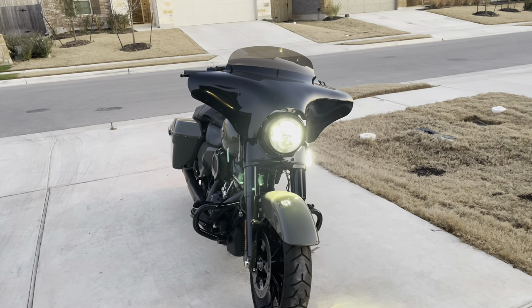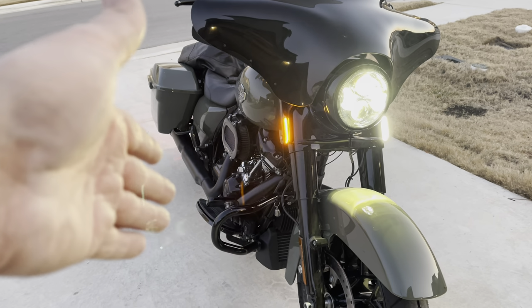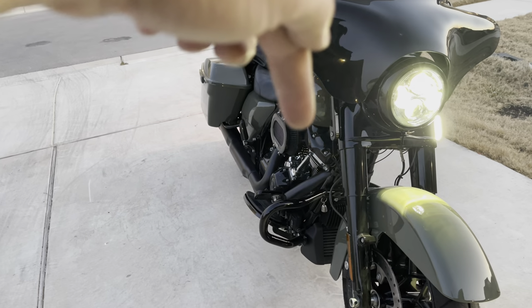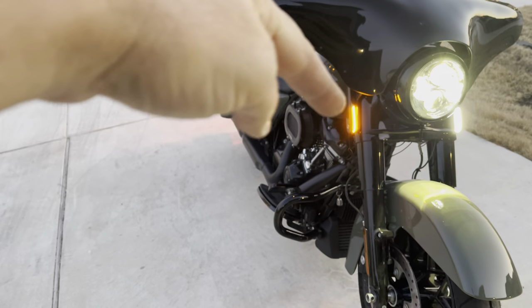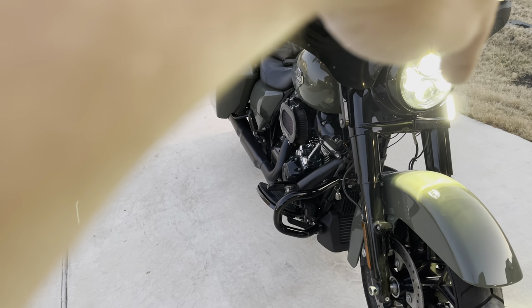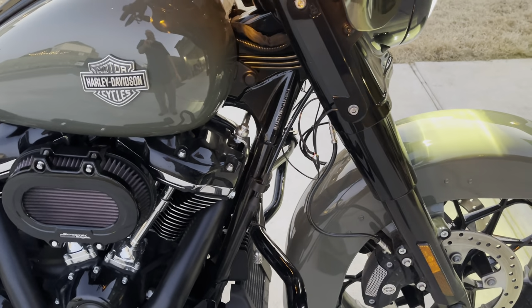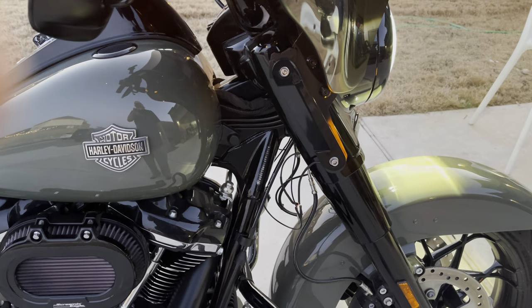Okay, so just once again, doing the right side here. We had to disconnect it over on the left side, run it behind the light, pull it back through. I spliced everything here because I had more of the cable out. Then I had to run it back behind the light, go ahead and plug it back into the harness. And then I'm gonna grab some zip ties and clean up the jungle of wire here, tuck it up nice and neat, and we'll be good to go.